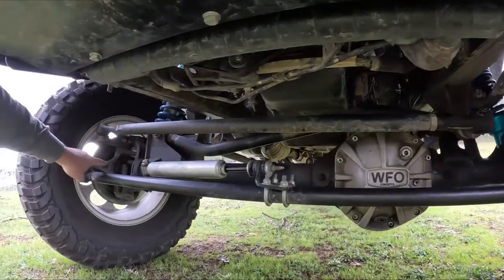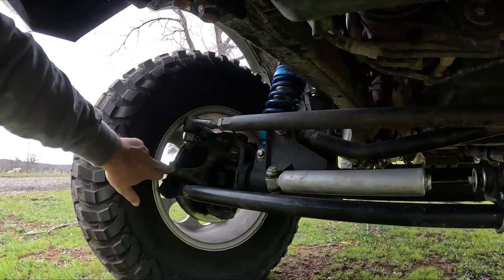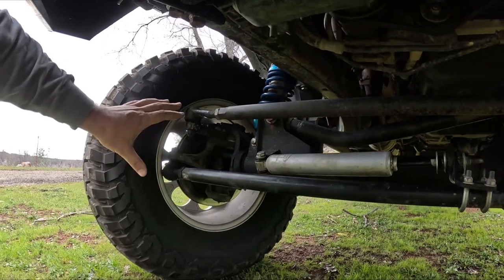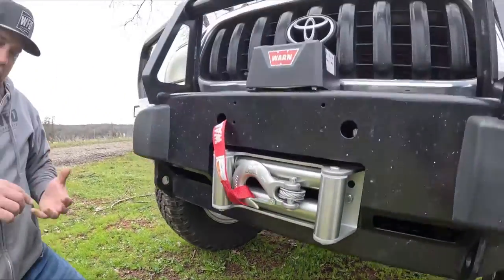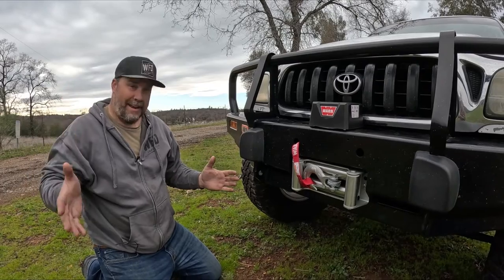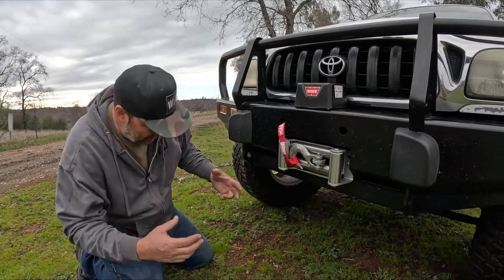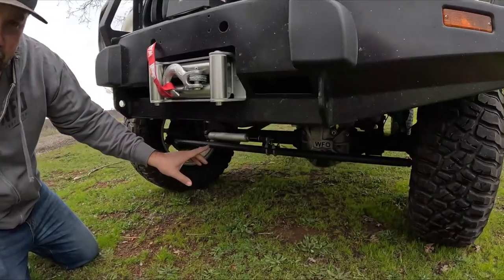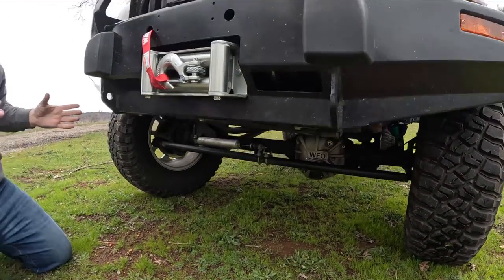If you look over here, you can see just standard Chevy 6-bolt spindles with our crossover steering arm and the tie rod down low in the factory Chevy location. This allowed us to make this truck 6-lug. So it had a donor 78-79 front axle from a Ford, another donor axle from a 71 to 87 GM where we used all the outers, and then we kind of slapped it all together. 488 gears front and rear, and we just put an Eaton e-locker in the front, and it has the factory TRD locker in the rear with 2-inch wheel spacers.